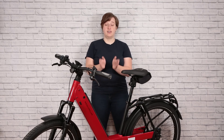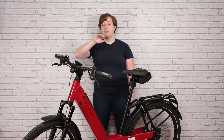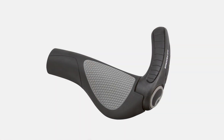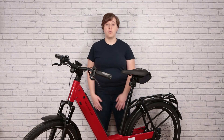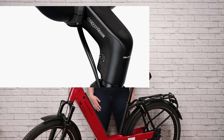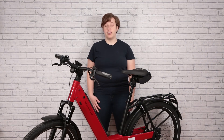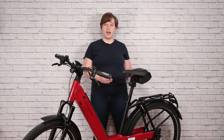Now we've come to a junction point on this bike — you can either choose the GX option or the heavy duty option, but not both. The GX option is designed for on-road as well as off-road riding, featuring Schwalbe Smart Sam tires with a low profile in the middle making them quick on roads, but grippy, knobby edges making them excellent at cornering on dirt track. They also come with GP3 grips designed by doctors in Germany, giving you a secondary hand position. The heavy duty package is for riders who are larger or want extra carrying capability, including a reinforced handlebar, stem, and pedals. This brings the maximum rider weight limit from 310 pounds up to 350, and as a bonus comes with a wider saddle for comfort.